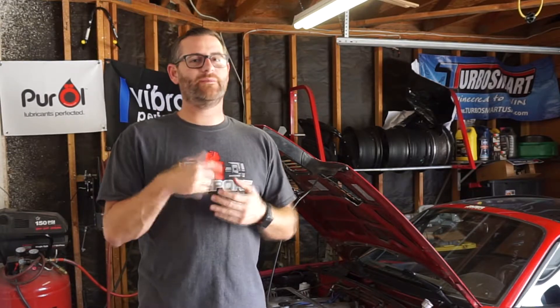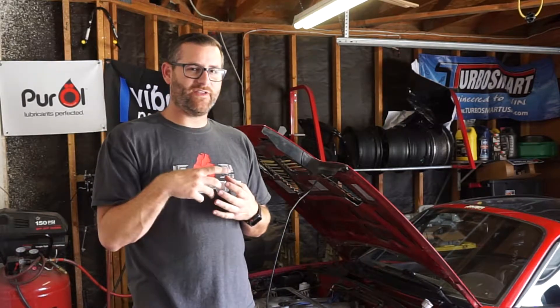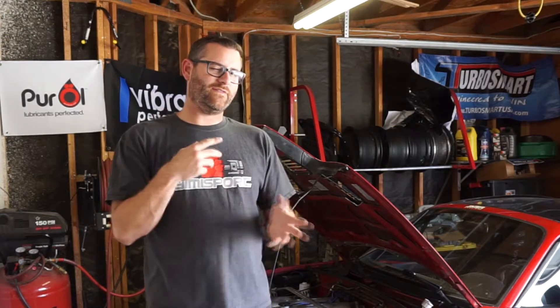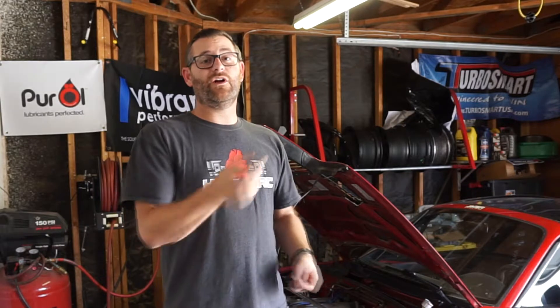Welcome back to the channel. As you know, I did a 1.8 swap on the Miata to get a little more torque and horsepower, and recently I've added a wideband to monitor air-fuel ratios and a fuel pressure regulator to dial it up or down. If you have a 1.8 with EGR, the on-rail Aeromotive regulator doesn't really fit, so I'm going to show you how to do it with a different style of fuel pressure regulator that also works with EGR. I also like the look of mounting it on the firewall, and this one's black which I prefer.